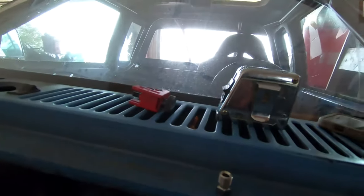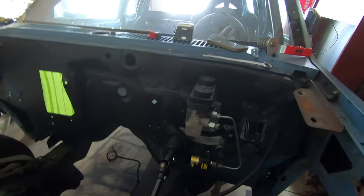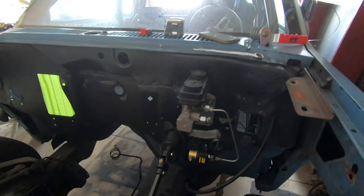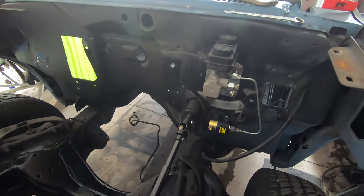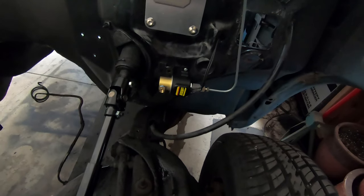Got this line on here. What I'm going to do is flare it and attach it to the back side. I did realize the fittings on the axle in the rear are different than what I thought — I thought they were 3/8x24 brake flare fittings, but they're actually 1/8x27 NPT. So I'm going to have to find more NPT fittings, which means I probably won't finish the brake lines today. I'll go ahead and wire up the line lock solenoid so I can at least show you that.